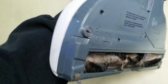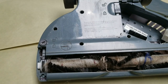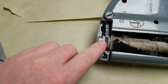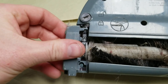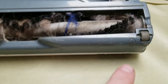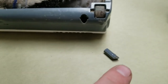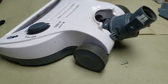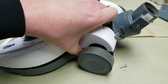I'm going to start by taking the Phillips head screws out of the back. You've got to take the battery out — there's a screw in there — and you need to take off the cover that goes over that because there's a screw in there. There might also be one in here — there is a screw in there. I just took the screwdriver and slid that up and out. After the screws are out you drop this down, it becomes loose, and then you can pop it off.